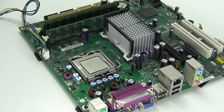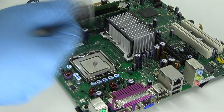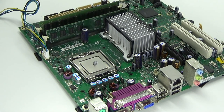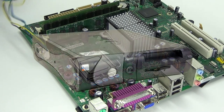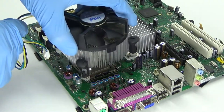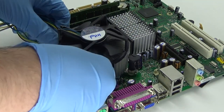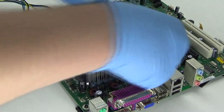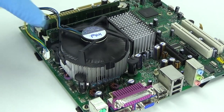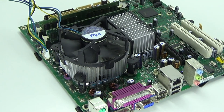80 degrees. Remember, this motherboard is sitting on a bench with no restrictions and all the air it can get, and it's reaching 80 degrees. Imagine putting this into a mid-2000s beige case with poor ventilation, or a Dell Optiplex clamshell. So it sounded good — a Pentium 4 with essentially a second processor on board, up to a 60% performance increase. But then you look at all the drawbacks: using about as much power as two AMD PCs of its time, and insanely high temperatures that will only get worse as the case fills up with dust.